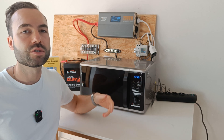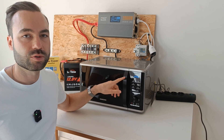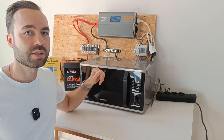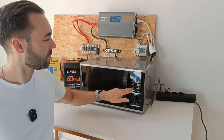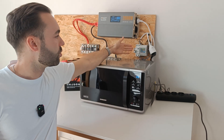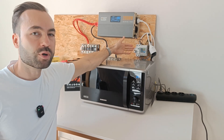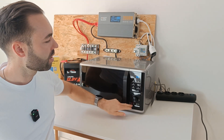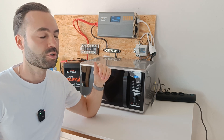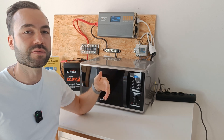So is there a way to reduce the power draw from the microwave? What if we set 100 watts on the microwave — will it also be pulling 100 watts on the input? I'll be setting it to 100 watts and press start. As you see it's drawing more power — it's drawing 1400 watts. So it's cycling between 0 and 100 percent, which means with a normal inverter, reducing the power setting is not possible.